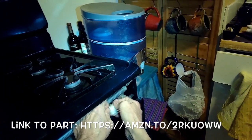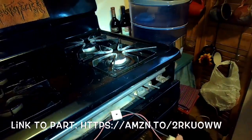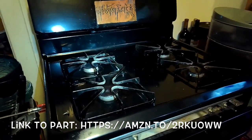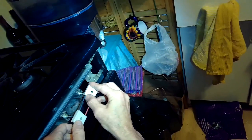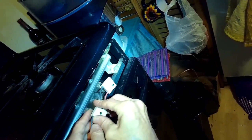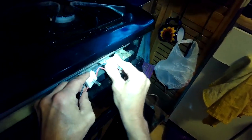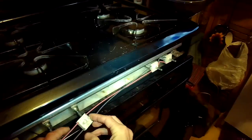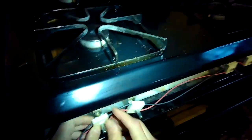There's a little link here you can use too. I'm just pulling these off one by one — the old switches — just got to yank them out towards you. This one had five switches, which is interesting because there's only four burners; the new one comes with just four. I'm going to push it onto these burner stems and just take your time, wiggle them on — they have a little keyed slot so they only go one way. Once you get them all the way in, give them a good push and they'll snap into position.